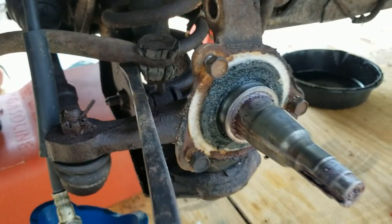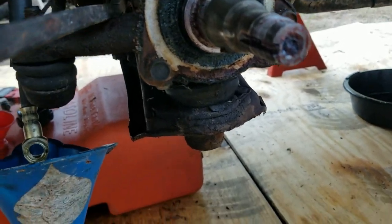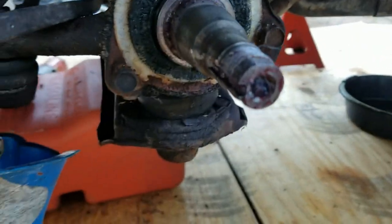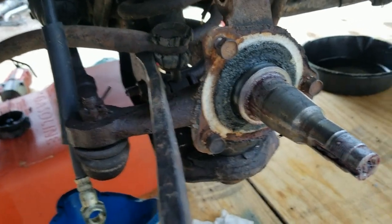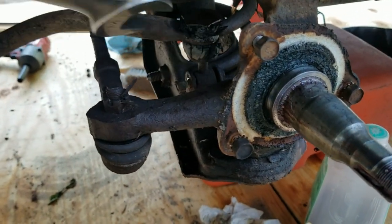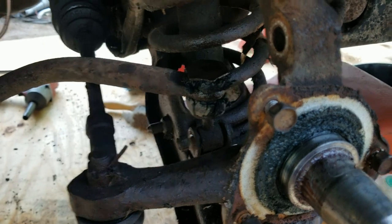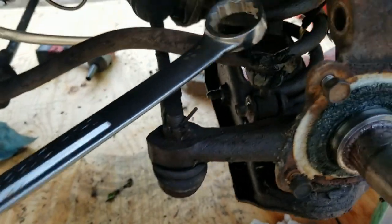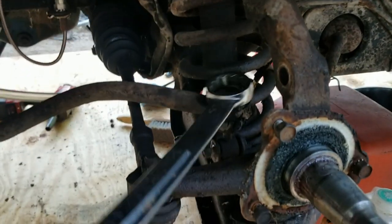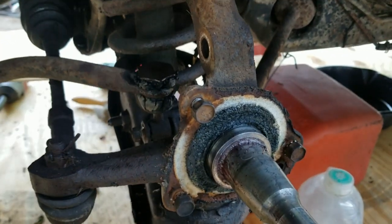So I was in here trying to pry out the sway bar — now watch this ball joint. I think it's bad. Can't get that to come up out of the hole, but then I notice that it's got a hex on it. So maybe I have a wrench that big — and apparently I do, it's the biggest one I have, inch and a quarter. It seems to be turning, so maybe we can get that off this way. I think I have new bushings for that anyway, so let's see what we can do.